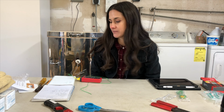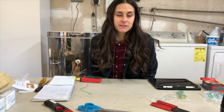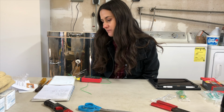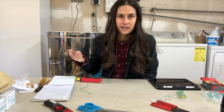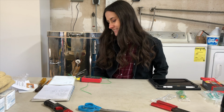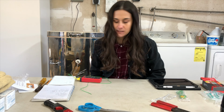Okay. I have done this stupid thermometer thing so many times. I have unscrewed it and screwed it and unscrewed it and screwed it. And against all reason, I tried reversing it and hooking up the yellow to the negative and the red to the positive, which goes against everything that I found online. And it worked. When I flipped it the other way, it kept reading negative. I flipped it technically the wrong way and now it's working. So it's now reading 175 degrees and counting.